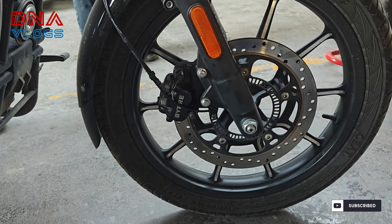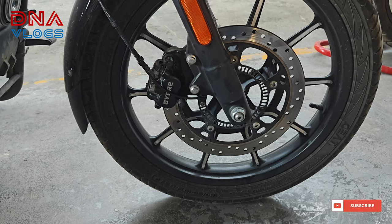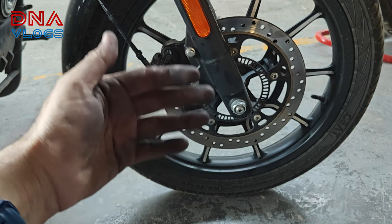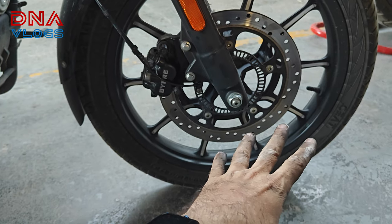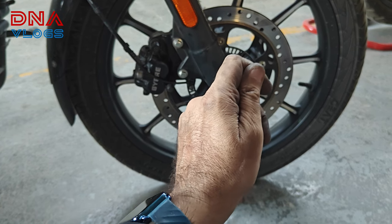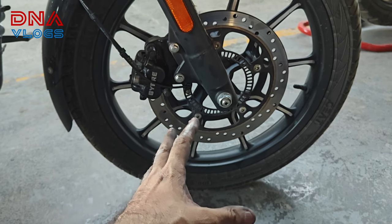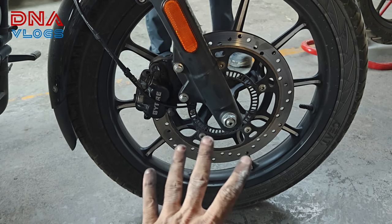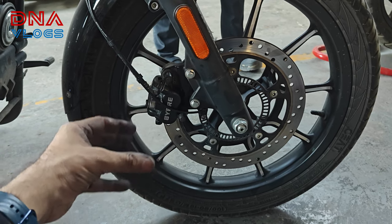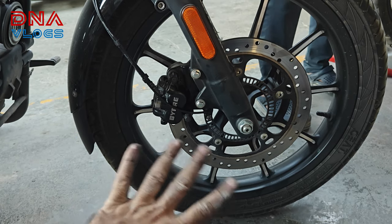Now going for a test ride. If there is major feedback, we will open it up; otherwise, the brake pads are placed. They need to bed in with the worn-out disc, because the disc was touched on one side. So the brake pads will take some time to match — about 50 to 100 km to sit in together. After that, you will get good braking performance.